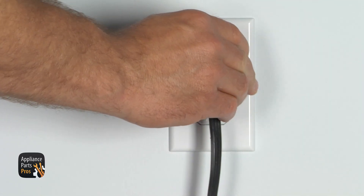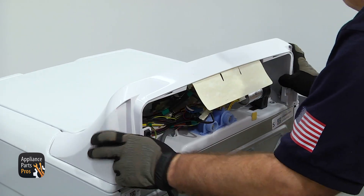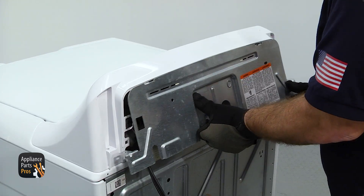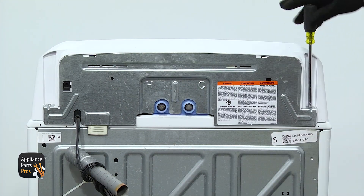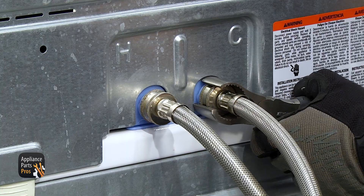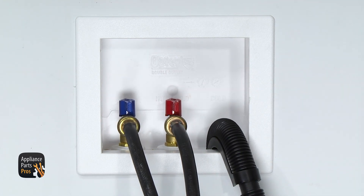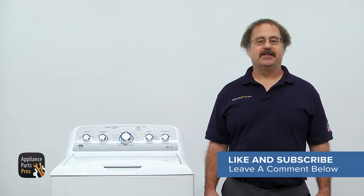So we're going to unplug the washer again. Then we can flip the console over and put it back in place. We can grab the access panel and put it back on, then use the quarter inch nut driver to put the screws back in to hold it down. Now that we have the console back in place, we can put the fill hoses back on, plug it back in, turn the water on, and put the drain hose back in. If your speed sensor tested bad, you can take your model number and search for the correct part at AppliancePartsPros.com. Most orders arrive within a couple business days. Make sure you let us know how the repair went in the comments. Thanks for your support, and we'll see you in the next one.